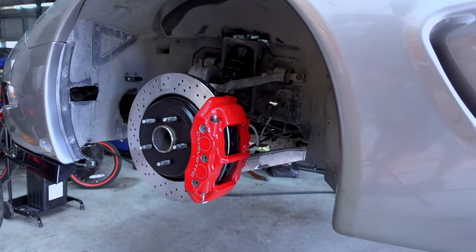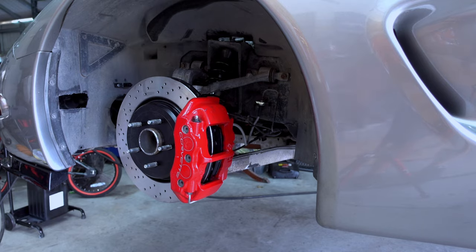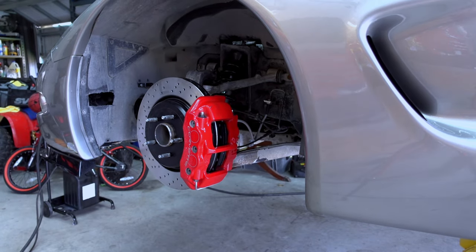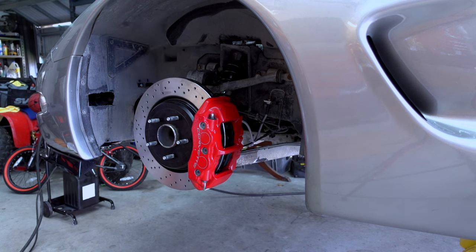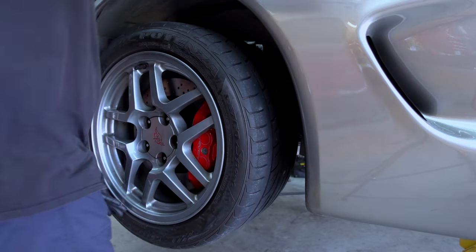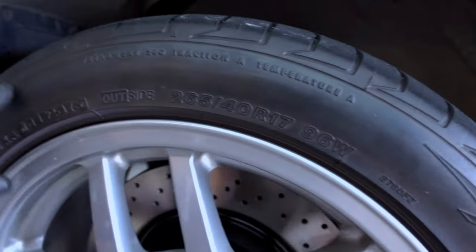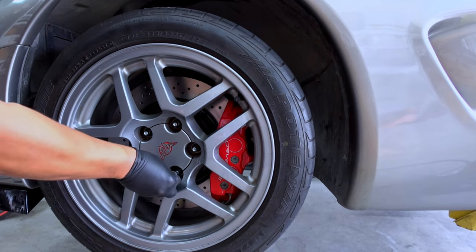System is bled, we're ready to put the tires back on and lower the car down for a test drive. I went ahead and brake cleaned everything off the back to make sure it's dry — if there's a leak, I'll know it's not from leftover brake residue. We're putting the 17-inch wheels back on. For those who might doubt — right there, 265/40/17 — it is a 17-inch wheel, not an 18, not a 19.